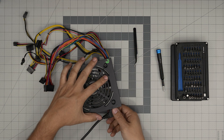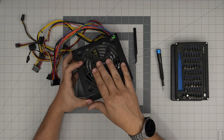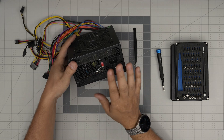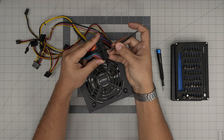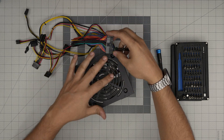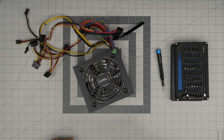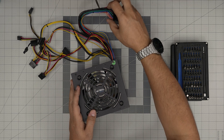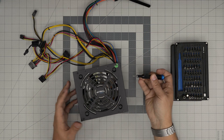Once you remove the shorting wire, the unit will shut down. But we need to discharge the capacitors completely. Once it's disconnected, grab the same 24-pin connector and short it again — leave it there while you're working. Before opening it, leave it for at least 30 seconds. This will discharge all the capacitors inside the unit so there is no risk of getting electrocuted. Leave it connected while we proceed.